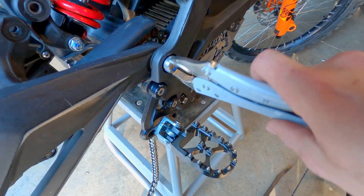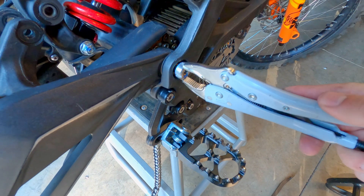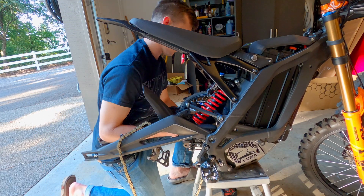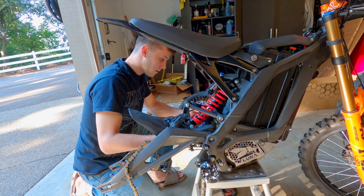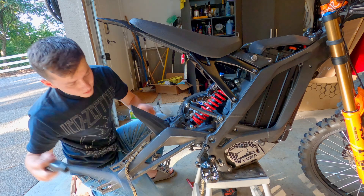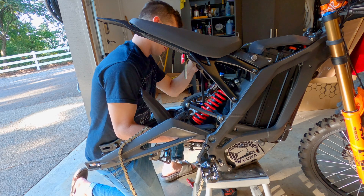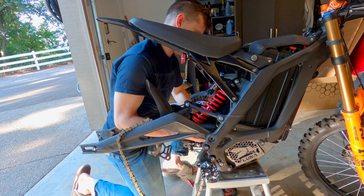I forgot to record it, but as you can see here the swing arm is detached from the suspension linkage — you're going to want to do this as you're not going to get the swing arm off unless you do. The next step is the most difficult: it is to remove the belt primary to secondary chain hub. This is in there pretty tightly and you just kind of have to hammer and pull it out. I ended up needing two hands and some help and it just took me a while, so I didn't really get it on footage — you just got to wiggle that thing out there.